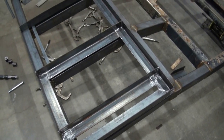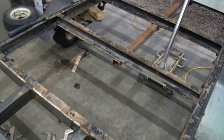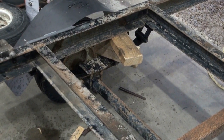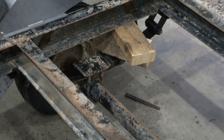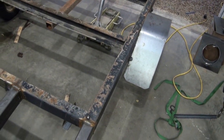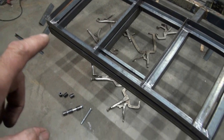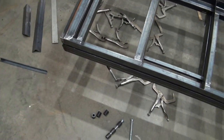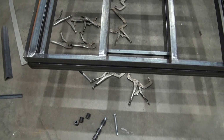It's still not finished, but it's to the point where I think I'd like to attempt to make some hinges for it now. I spent a bit of time trying to even out the frame from one side to the other, and it turns out that side the leaf spring is sagged out or something. So I've got it shimmed right now and it's pretty close from side to side — close enough that I think it's okay to try and make the hinges now.